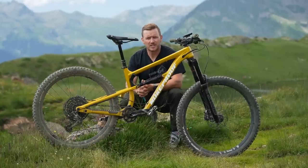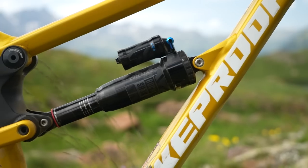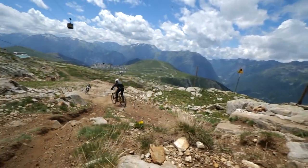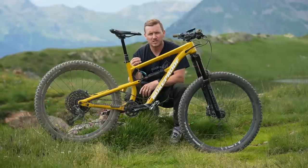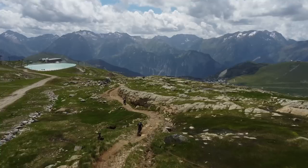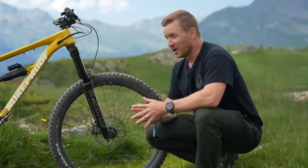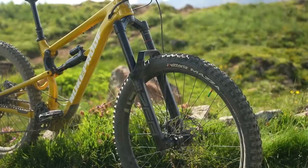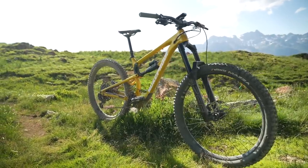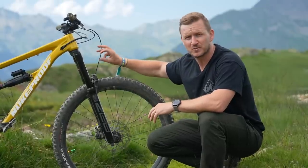Let's talk about the rear suspension. Straight out of the box, this bike comes with the Rockshox Super Deluxe Select Plus — 165mm of travel. He weighs 71 kilos, so we've added one band and a little more pressure above his recommended level for his weight, because the terrain is gnarly and we don't want it to blow out too much. At the front, the forks are the Rockshox Zeb Select Plus — 170mm of travel. We've added three tokens and again a little more pressure in the front as well.